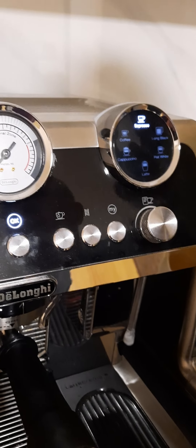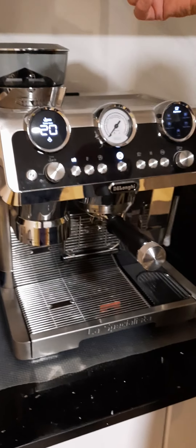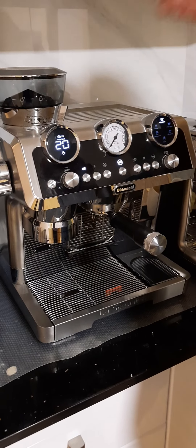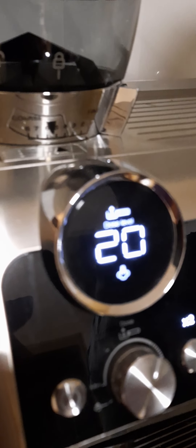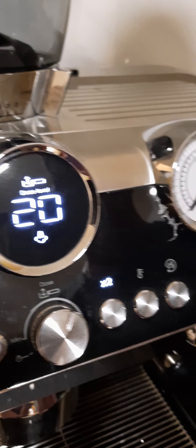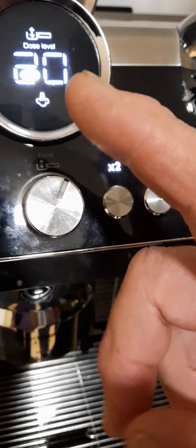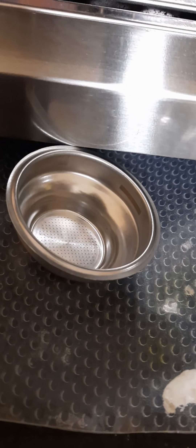In a nutshell, take care of your machine. Always keep your grinder burrs cleaned — preferably at the end of each bag, or if you're using a one kilo bag, perhaps halfway through. Make small adjustments to your grinder settings and dose until you get your brew right. If you're using your single basket, make sure you don't have your two-shot light on — we had it on a dose level of 20 for our first extraction, so for a single basket you'd be down around 10.